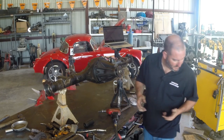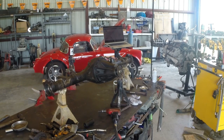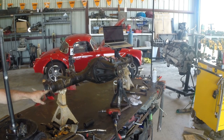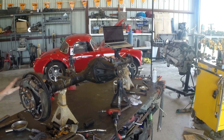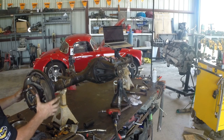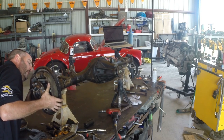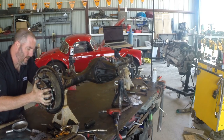Now it's time to slide the axles back in and turn this thing into a diff again. There's a seal right here that you would normally replace — it seals against this surface. When you're sliding this in, you want to be very careful not to damage that seal. Gravity causes that axle to want to climb up at one end and pivot, so in order to hit that side gear you're going to have to line this up a little bit and get it to slide in. And there she goes — now I just got to hit the holes in the diff housing. There it goes. Brakes up — and she goes.